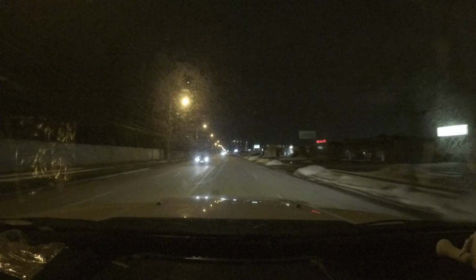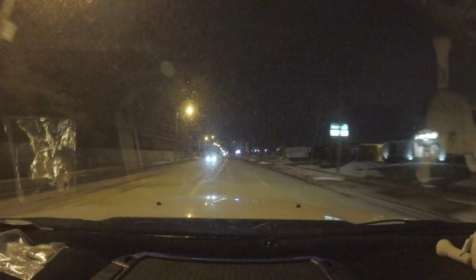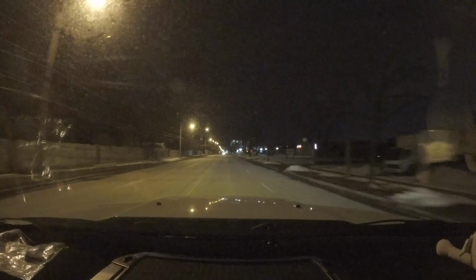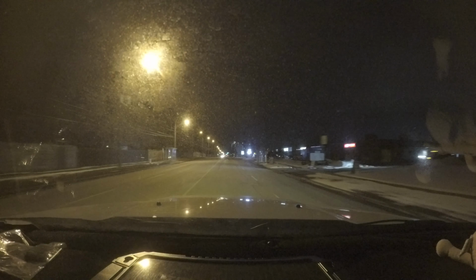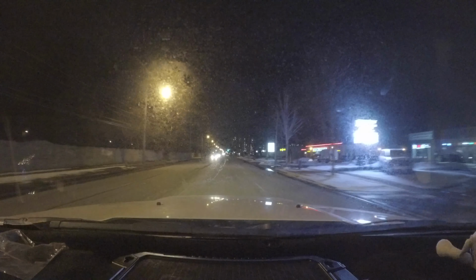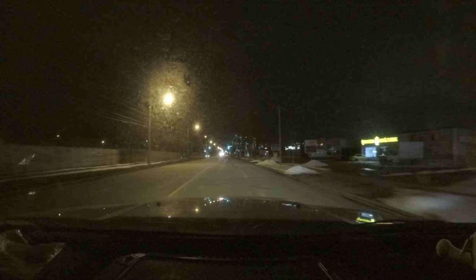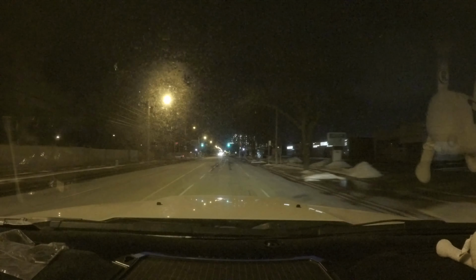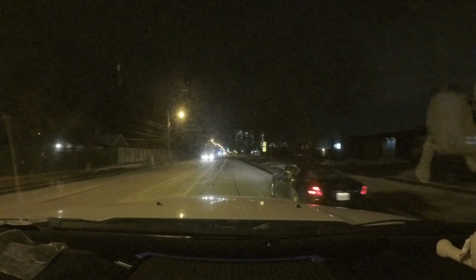In some of the versions of this pickup truck you can get something that is referred to as an all-wheel drive transfer case. Let me explain how that one works. I believe that one is a Borg 44-44, and it has the same knob settings, dial settings as this transfer case does. It is electronically shifted by a rotary knob that is located on the dashboard to the right of the driver, just beside the steering wheel.